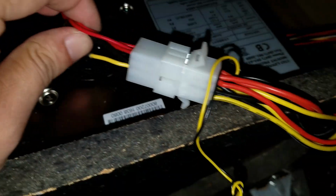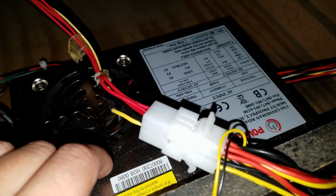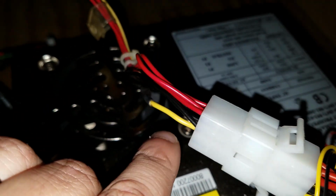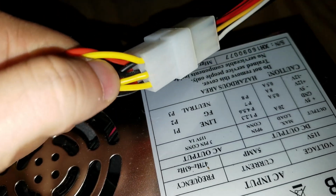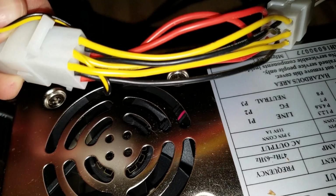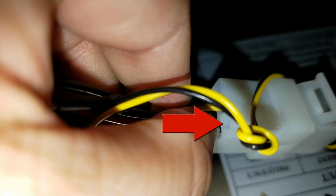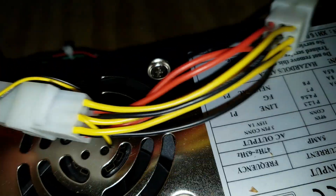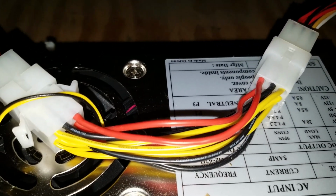Now when you do this, you have to make sure that these wires match up, in case something weird happened with your cabinet or whatever. But I personally repinned this connector to match the power supply, so everything matches. Now you can see we actually do have a white wire here that doesn't match. That's a white to a yellow, but it's going to be okay because once you follow that yellow, that one's going to basically the top left of your screen, and then we follow that and we see that there's no connection there. So that doesn't matter that doesn't match. I guess that's there maybe to support a different power supply or whatever, but there you have it. So this should be just fine.